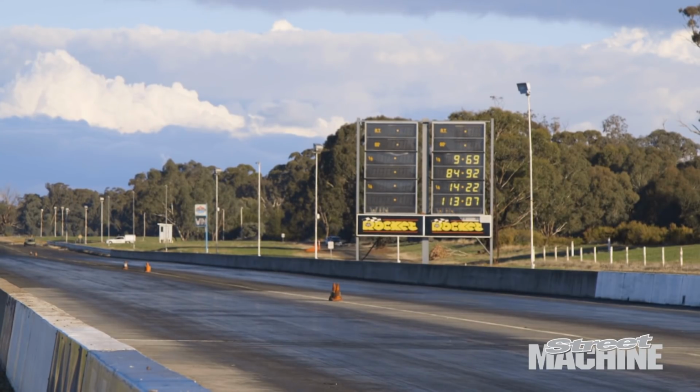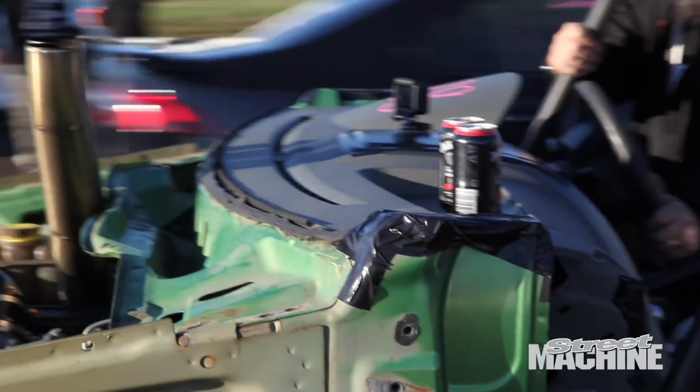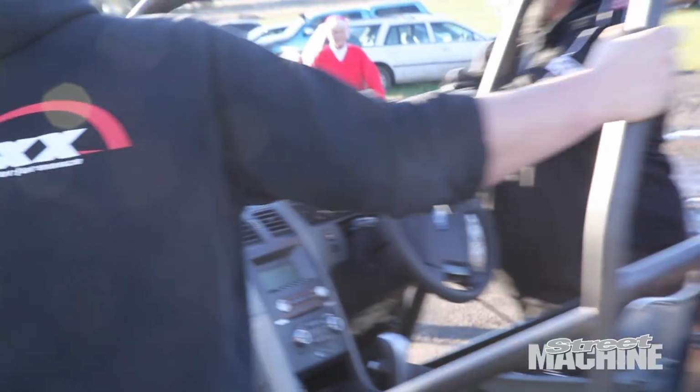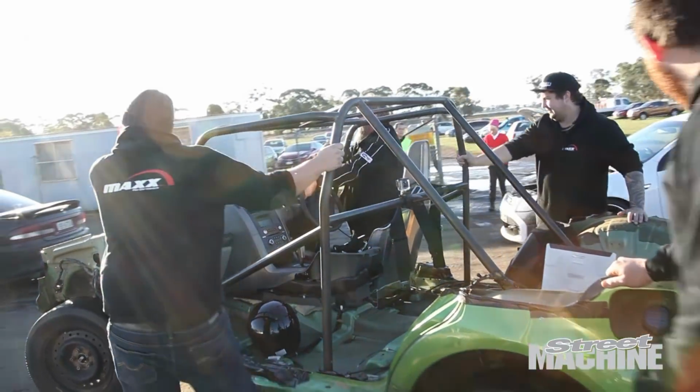Well, wasn't that all bad. Loaded it up on the converter too hard and just buzzed the tyres, got off it, tried it again, buzzed the tyres and just, yeah, not good. But it did run higher mile an hour because I short shifted it when I was actually shifting it. So it went higher mile an hour in the top end. So the potential's there.